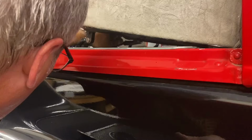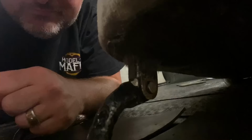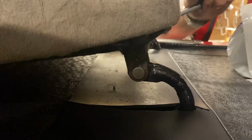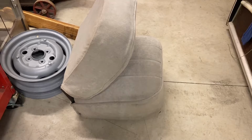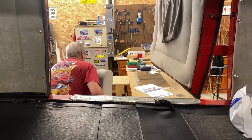Each front seat in our car is attached to the floor by seat legs with pins and cotter pins. If you've spent any time working on a Model A, then you're intimately familiar with the pure joy of attaching and removing cotter pins. The cotter pins underneath the seats are a bit hard to get at, but with a little time, effort, and most importantly, patience, they can be removed. Once the pins were out, we removed both the driver and passenger side seats.